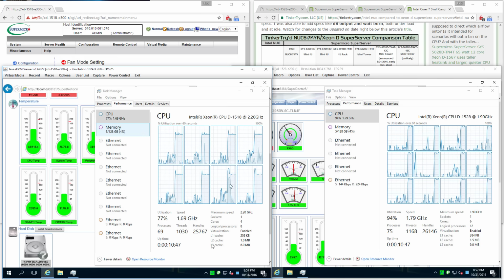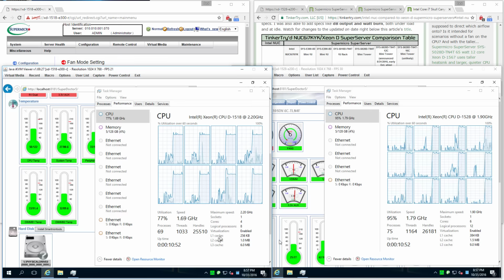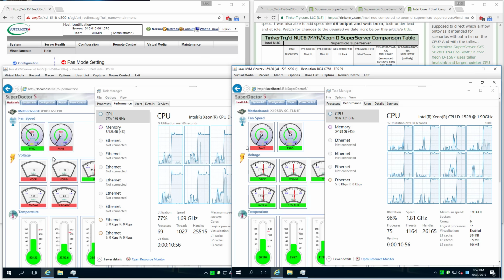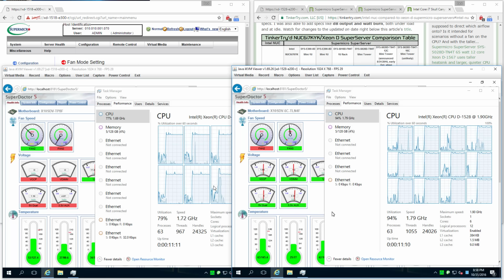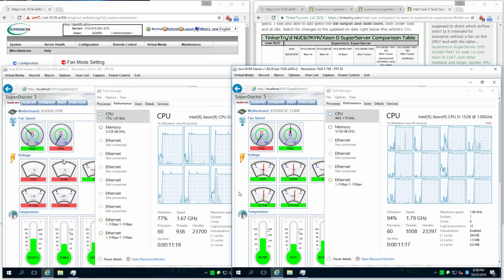So now we should have a similar number of threads on the two machines. They're pretty close, not identical. And temperature is showing in real time in the background there. That'd be good if I had the same screen. We can also see that there's only one fan. These are passively cooled as far as the heatsink, and one is a taller heatsink than the other to let hard drives clear or not. So I'll just point that out. The innards of the system differ as far as the cooling solution for the CPU, with a taller heatsink for when you have 6 cores versus 4.